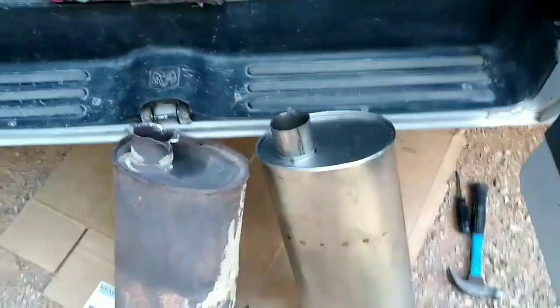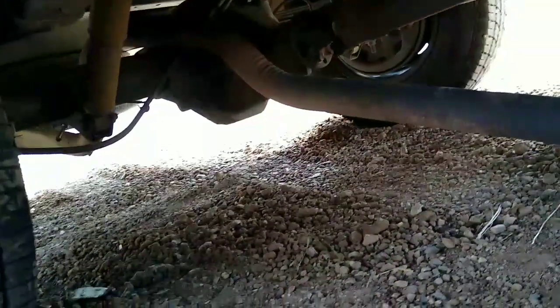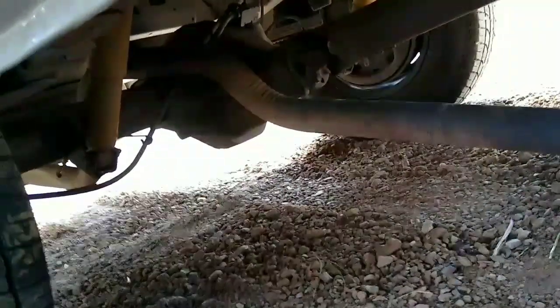It took a lot of work. I actually had to use my car jack to hoist this to put pressure. Of course, you don't want to use a hanger on your tailpipe. You don't ever want to put pressure on the hanger. That's critically important. And as for the tailpipe, there are control lines back there and also a metal brake line. If you're wrestling that tailpipe out, you do not want it smashing against your heavy-duty braided brake line.